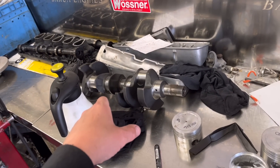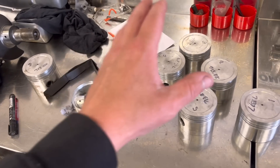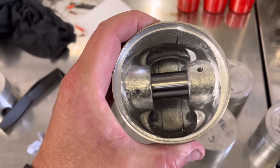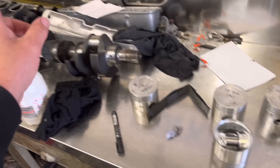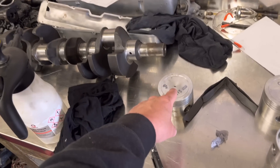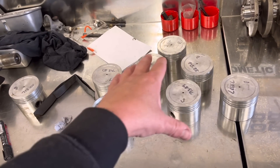So what has Paul been up to with the Rover V8? We've got the pistons here and what Paul is doing - before we send the crank assembly off to be balanced at CTM, because obviously we can't do the V8s at the moment - he's weighing and balancing all the pistons. He's done the con rods, checked the sizes, weighed all those, got them all perfect, now we're doing the pistons. These range from the lightest to the heaviest about 7 grams, so what he's doing - as you can see this is one of the heavy ones - he's removed material around here with the die grinder and put them in the lathe and just turned a bit out of the base, and he's managed to get them all pretty much spot on. So we'll gather up, we've got to order a clutch, and once the clutch arrives we'll face the flywheel, and we will send off all that with one piston - a complete piston assembly with rings, gudgeon pins, circlips, con rod bearings, rod bolts - so they know what the balance is, but it is important to get all these weighed before we do that.